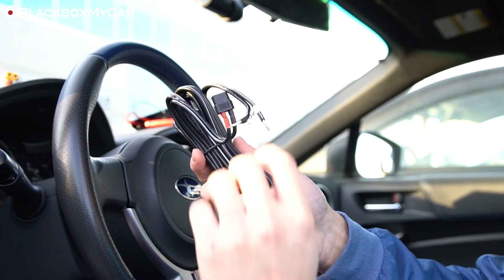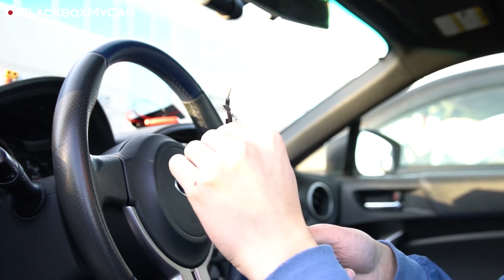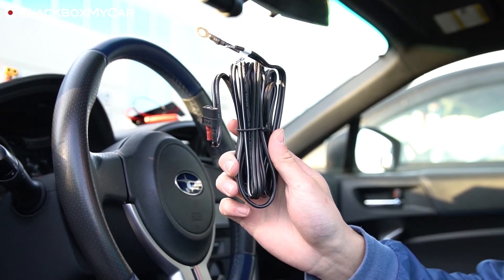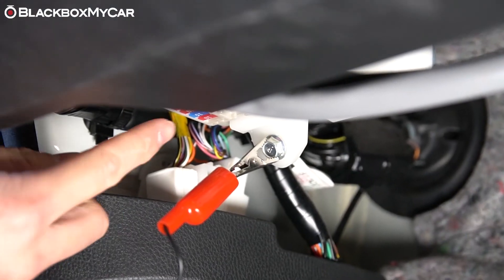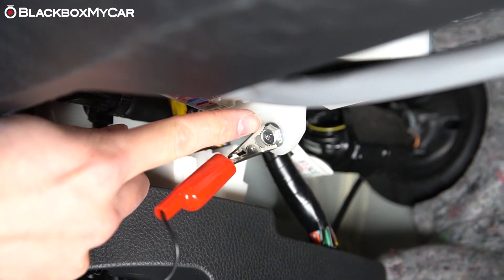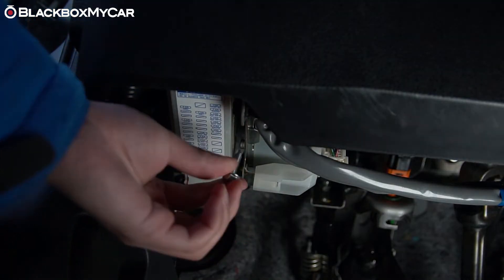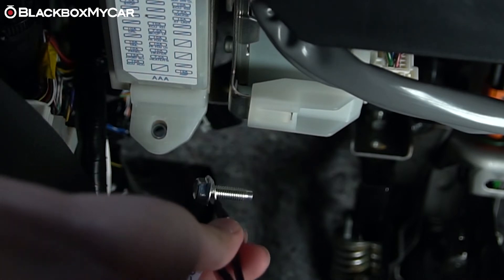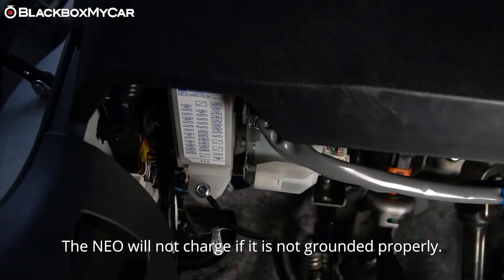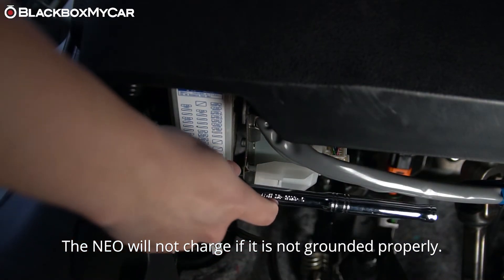The first wire that we're going to be looking at is the grounding wire. The grounding wire is the black wire with a circular metal ring protruding from it and exists to mediate the voltage from going to the units. The grounding wire needs to be hooked up to a grounding bolt, just like this one. You can do that by unscrewing the bolt and placing the ring from the wire onto the screw in between the bolt and the frame. With the ring set, tighten the screw so that the ground will not wiggle loose while driving.